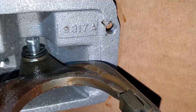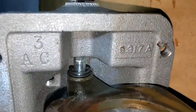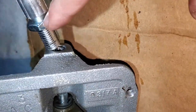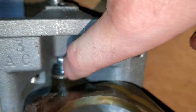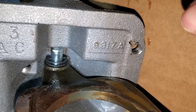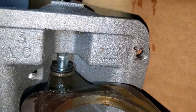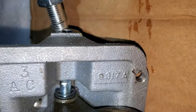All I need to do now is put a little bit of thread sealing on there, and I'm going to have to spin the casting around the cable - because the cable won't turn - to get it where it needs to be. Then go pull the cable and adjust it until that second snap ring is against the casting. I'm going to stop the camera while I put some thread sealing on and get it partway started in there, then pull the cable and come back.